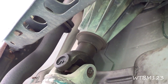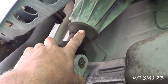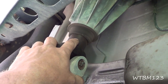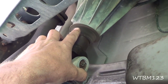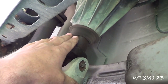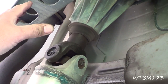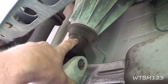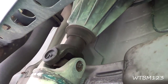If you've got the driveshaft loose at the rear end, right here this is a slip yoke that goes into this transfer case — it's basically the same as an automatic transmission. When you pull this out, this slip yoke, there's going to be fluid running out of here. A lot of times you're working on the front of the car and you've got the front jacked up, so it's going to make it even worse. You either want something underneath to catch it, and they also sell a plug that just fits up in when you take this out, and that'll stop your fluid from coming out.